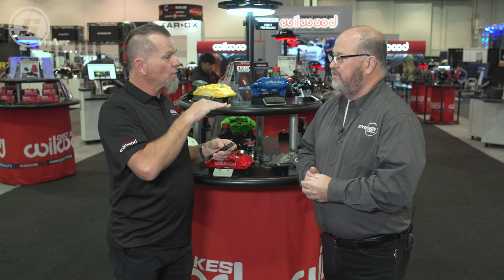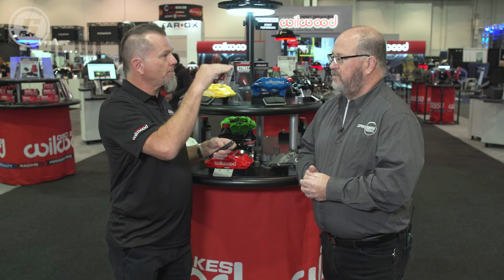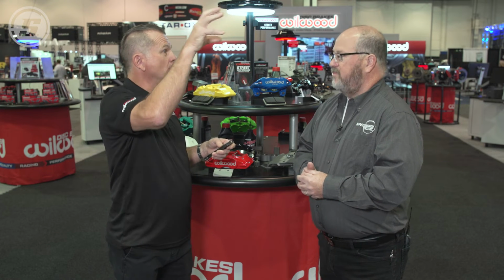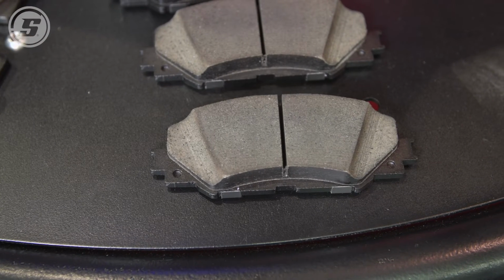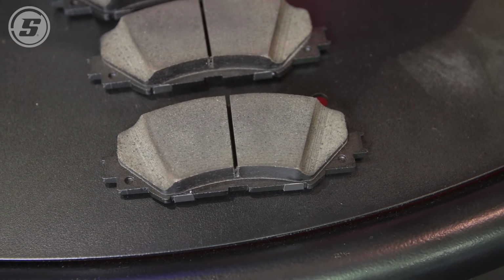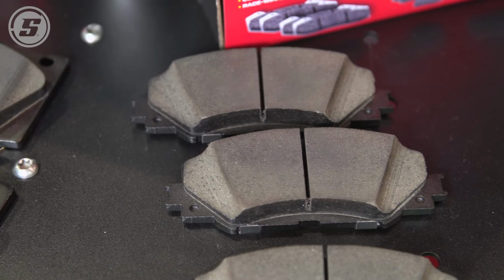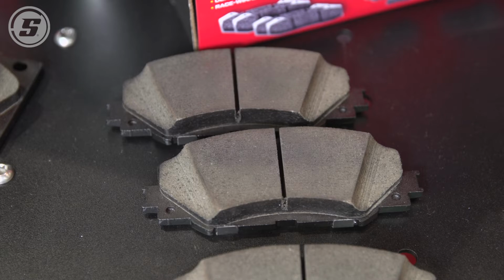So what starts to happen is we're increasing temperature, but we're not driving the temperature straight to a dramatic stage. So when you call Wilwood or Speedway, you say, I've got this car with this size wheel with these brakes. Once we know the weight of the car and how big of a brake system you have, we'll help you determine usually between 6 to 8 stops. So 45 to 20, 6 to 8 times.